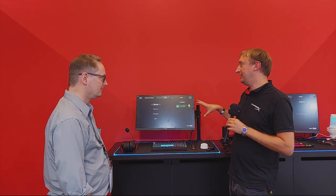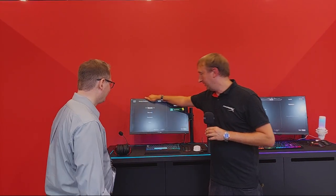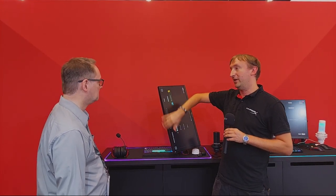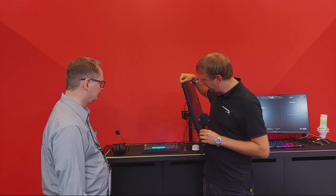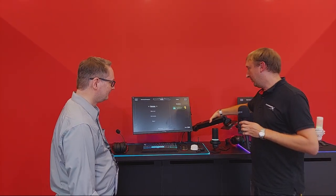One of the main features of the Armada 25 is that it comes with a mount arm rather than a standard monitor stand, giving full articulation — moving through 180 degrees in either direction. The monitor's cooling allows placement in any direction without overheating. The power supply is built into the monitor, eliminating the power brick. It includes a 3-meter DisplayPort cable, and the arm has a proprietary plate with an eject button for easy monitor attachment and removal. A standard VESA 100 or VESA 75 mount is also included in the box.